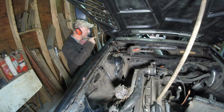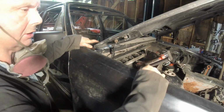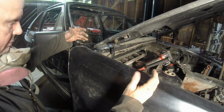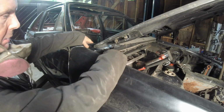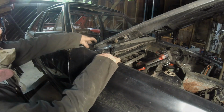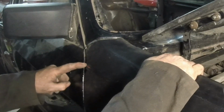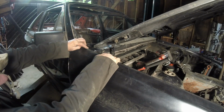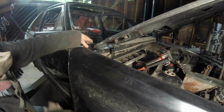Take a look at this where it's just one little click hold and I have one bolt in the other side. I'll show you how much better it looks. Take a look at this backside. With just this little clamp on right here, it is really close. Now, if I push down like this to push that metal piece down where I'm going to weld it, and I pull it out to give me some type of a gap right here, this almost closes. It's very, very close. And I find that is going to be the final position of it right there.